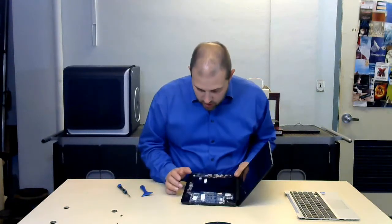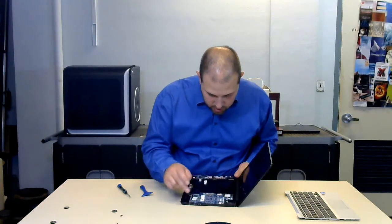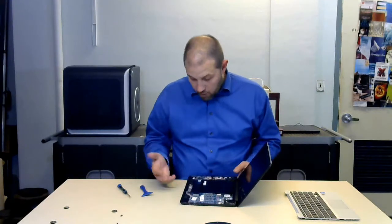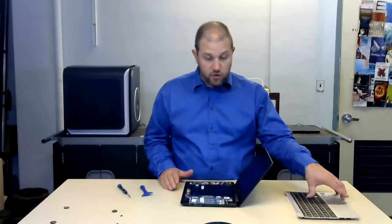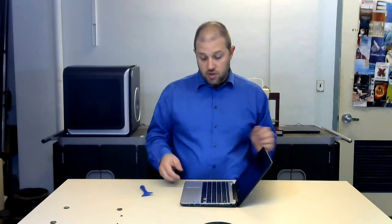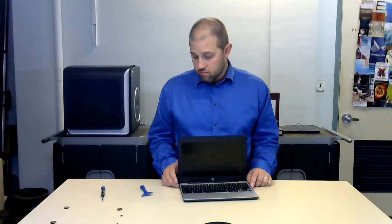The Chromebook is light. The motherboard is going to come out with one, two, three screws, so if you need to change the motherboard that's pretty easy. For repairability, I would say this is actually quite fixable in terms of the keyboard. The only hard part with fixing this one is the stickers and the screws in the awkward spot. As for placement of items, it's really good, and the lightness is really good. So the HP Chromebook 11 G5 — I think it would be a great Chromebook for schools, keeping in mind some of the repairability is awkward, but definitely a decent machine.